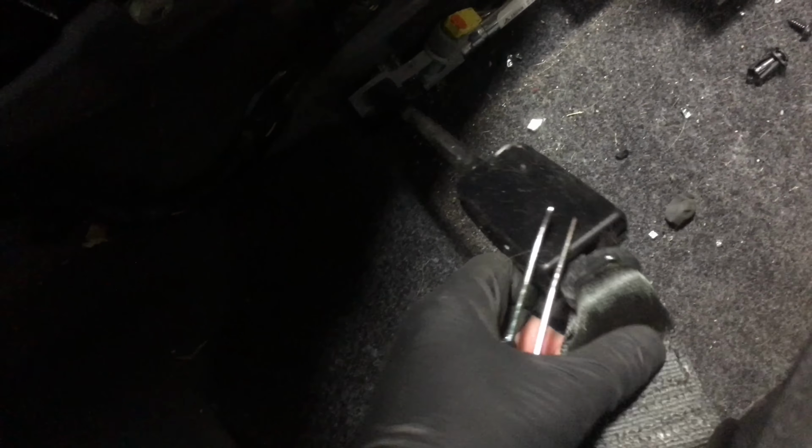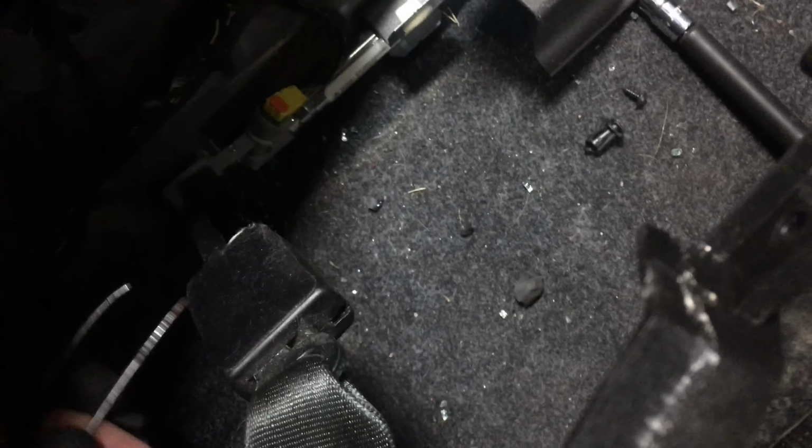Well, the front seats are out, the rear seats are out. I'm working on the seat belts. On these cars, there's a little anchor at the bottom of the belt, and in order to remove your trim panels intact, you have to unhook the seat belt from this. There's one tab on the top right here, that little black thing, and there's one on the side here. Decided to turn on the light. So there's a notch right there on the top and there's one on the side. How you do this is you take a straight pick and you push it in until you feel some resistance.